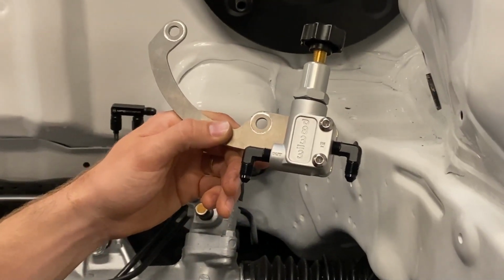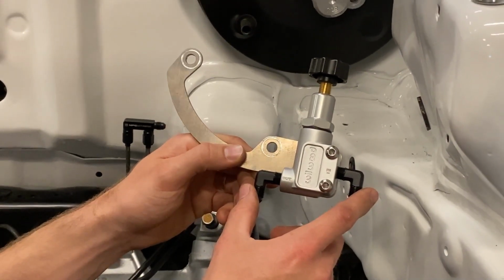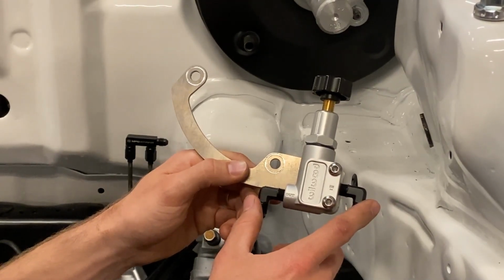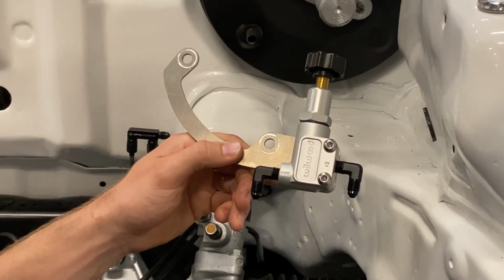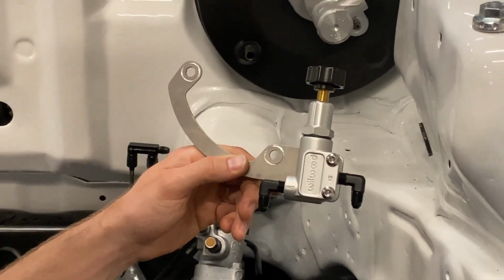Okay. So now it's time to install the prop valve. And you'll notice these two adapter fittings, for you guys and your kits, they're gonna come pre-installed. So you don't have to worry with that. These are the only fittings in this particular kit that are pipe fittings that use sealant. Everything else seals on the flares. So do not try and tape any of the fittings that you install.